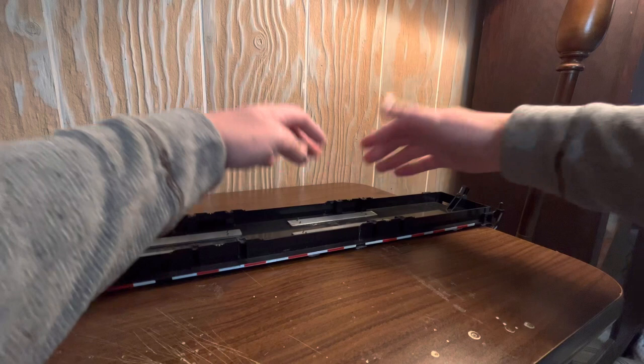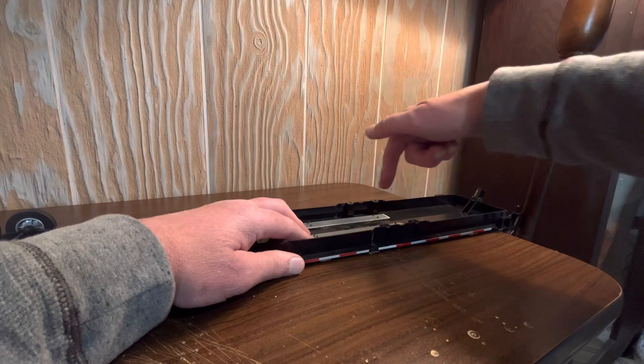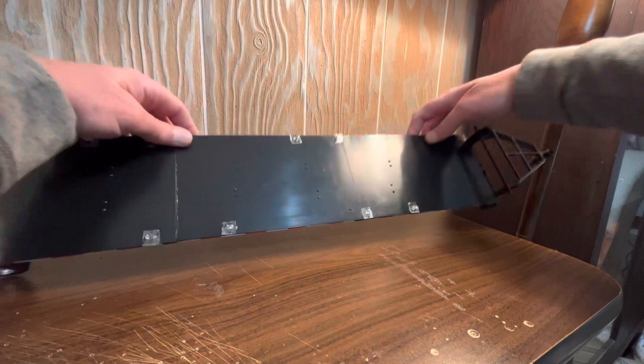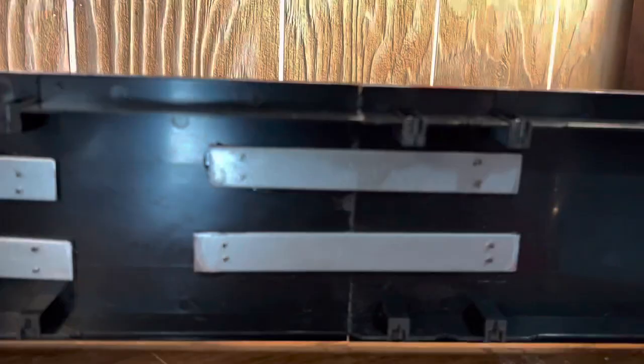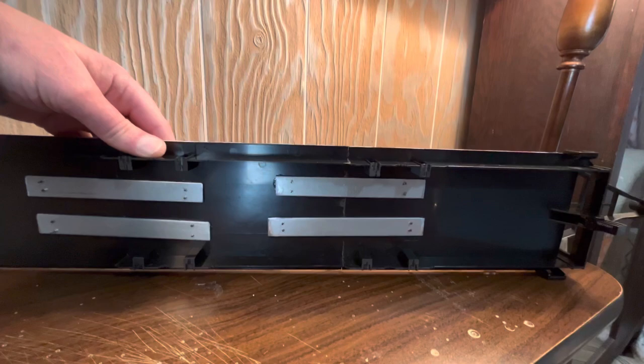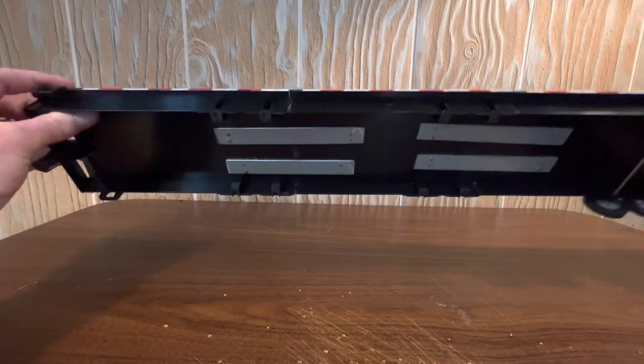And then after it finished drying, which probably wasn't completely dry, but dry enough to hold it to where it wasn't going to move, I then ran the drill bit through the holes I already drilled and just popped a little hole through the trailer. That way my holes line up. And not only is this being held by screws, but it's also being held by the Gorilla Glue. Then I just put a screw on it, put a nut on the back side. And voila, got a triple trailer and it's very secure. You know, not too worried about it coming apart on me.